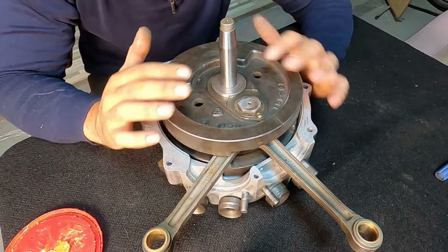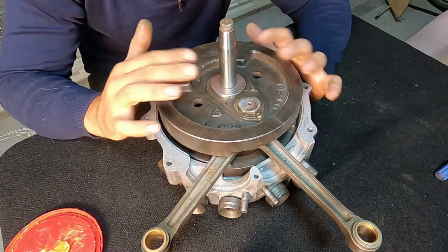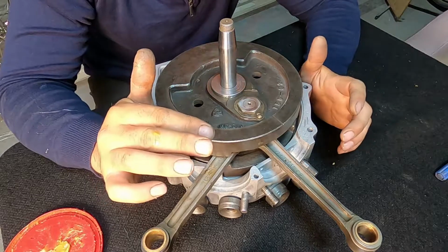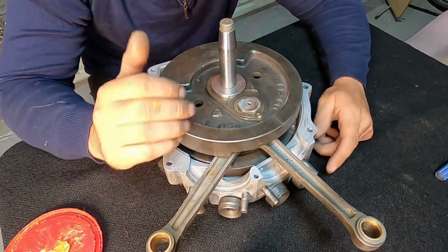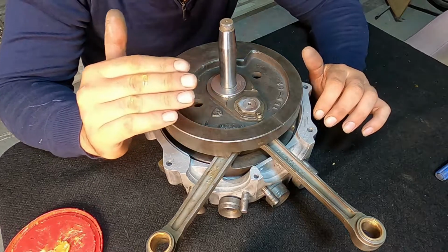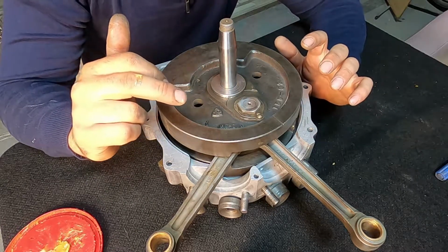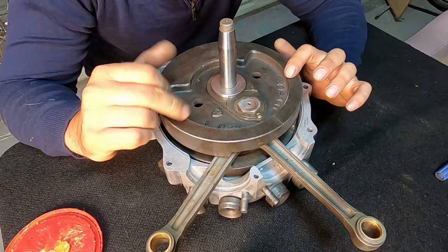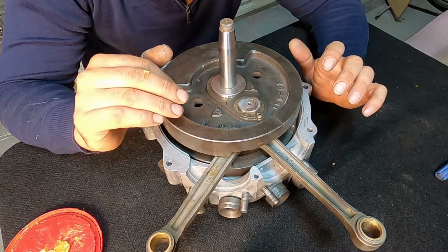I was first mounting the thrust washers to see if I'm correct in the side play without rollers. Now that I could see there's no big play, I will mount the rollers and tighten the crankcases a bit to see if I still have play or if it's getting stuck. Perfect would be to see that it is getting a little bit stuck, so I can still sand a little bit from the spacers and have the correct play.